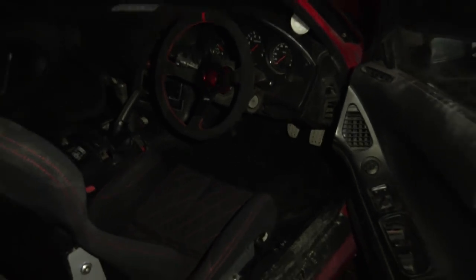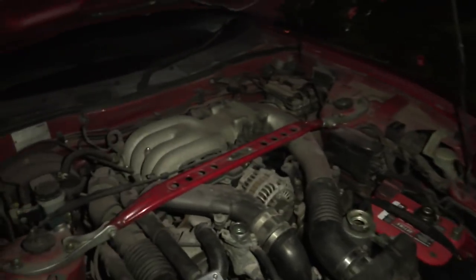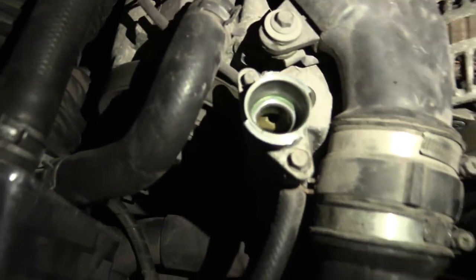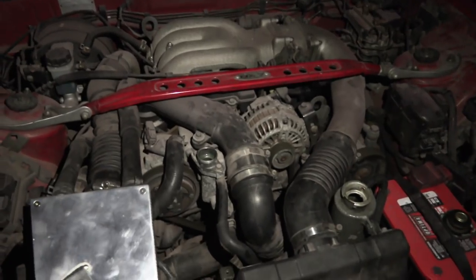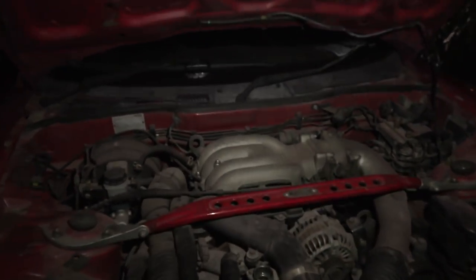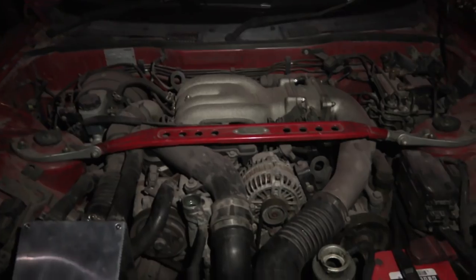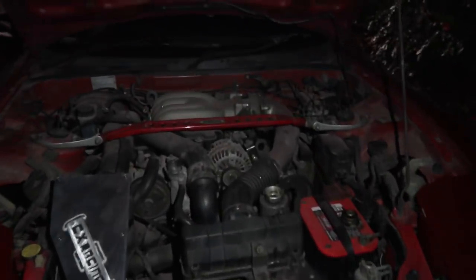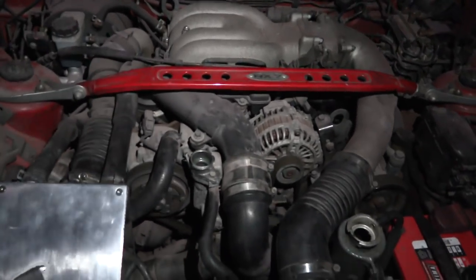My plan to just drive away into glory didn't work. Two things happened: I noticed the dash has no lights on it, and when I popped the hood, the coolant low siren went off like crazy and there's almost no coolant in there. We need to put the funnel on, run the system, let it heat cycle multiple times, and bleed off any air bubbles. While doing that, I'll check for any blown fuses under the dash that could be causing the missing dash illumination.